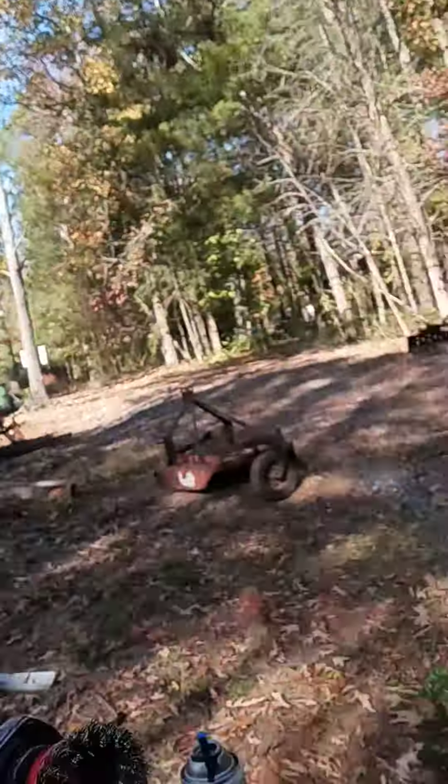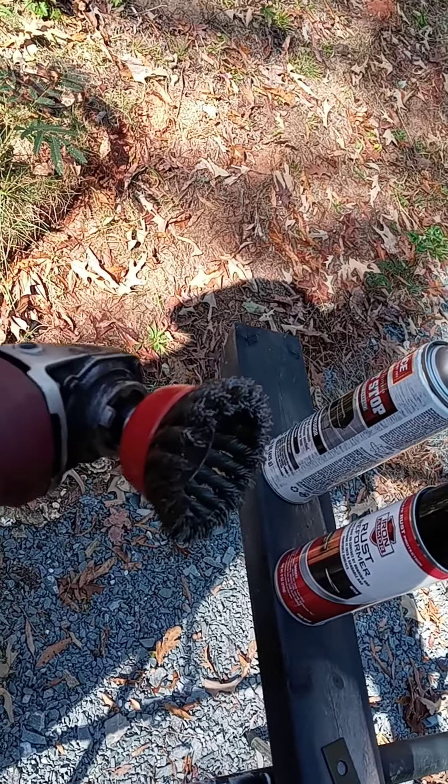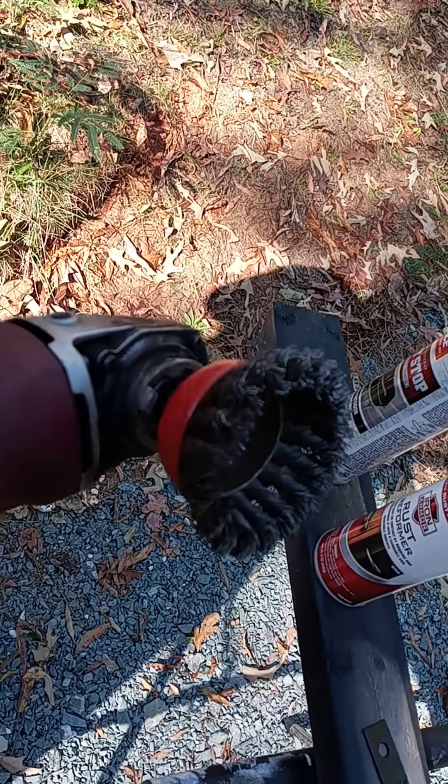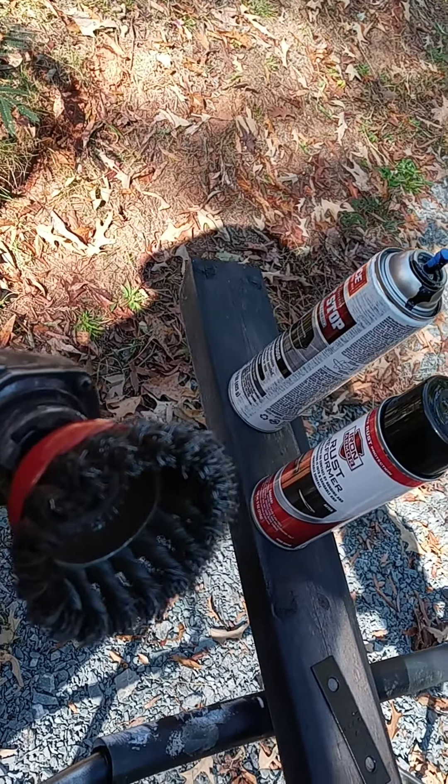Just showing you what I'm doing here today. I've got some panels and I'm cleaning them and painting them — they are pretty heavily pitted and rusted. Not having access to a really good sandblaster, I'm just using this knotted wire wheel, and that works very well. It gets a lot of the heavy rust off and takes a lot of the paint off.